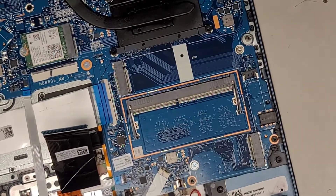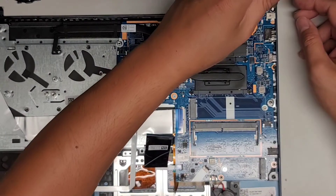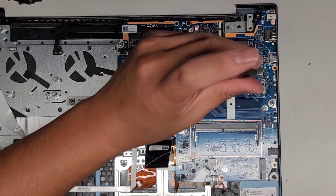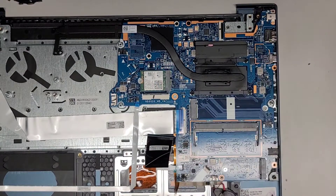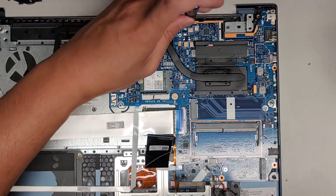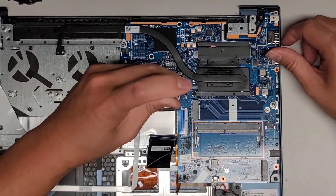Let's zoom out and get the rest of the screws out to pull the motherboard out. We're going to start removing all these screws. They have little white arrows pointing to where the screws came from, so keep track of that. There's also one all the way up here. We're going to go over to the side — there's one silver one right here in the middle.